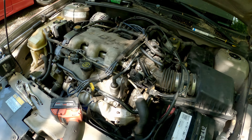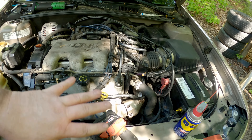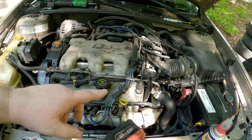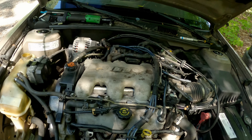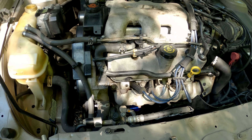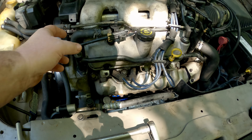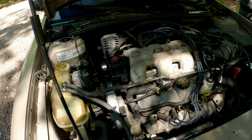Now that it is all back together, what I like to do next is dump the oil, because if anything got into the valley and got down in the oil pan we want to clean that out - if any coolant went down in the oil pan I just want to dump that out. So we're going to dump the oil, refill that, put coolant in it, and then it's ready to test start. When you're doing the coolant you have to bleed it, so I'm opening this bleeder and adding coolant until I see coolant come out here. Then I'll probably start it, let it run for a few minutes, crack this a couple times to bleed any additional air out, and then it should be good to go.